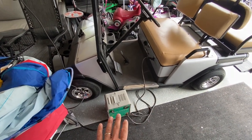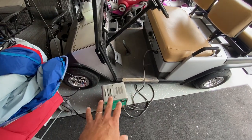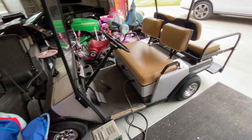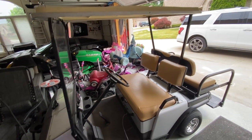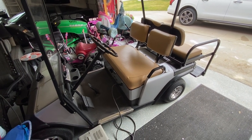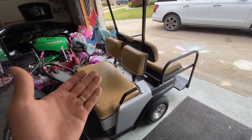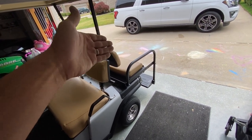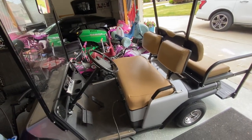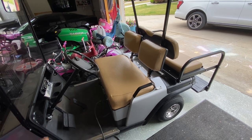As far as the conversion goes, if you go to a 3x12-volt system or a 4x12-volt system on a 48-volt golf cart, you can still use the original charger — just keep an eye on the battery levels and you'll be fine. Overall, this is a great little golf cart. I like the roof, the windshield, all that stuff. If you buy these right, you can always sell them for what you got into it. Everything I did to it I did myself — the front seats were reupholstered by me to match the rear seat, plus the sound system, the rear-view mirror. These little things are very cheap but make a big difference whether you're going to use it or sell it, because that's what people want. All right, talk to you guys later.